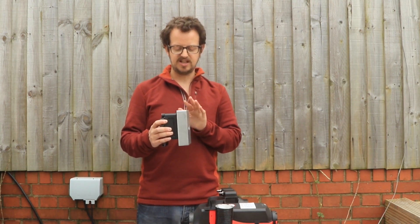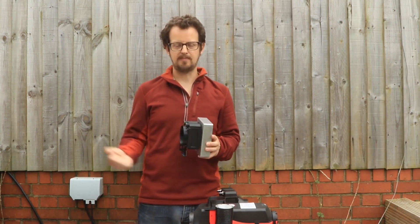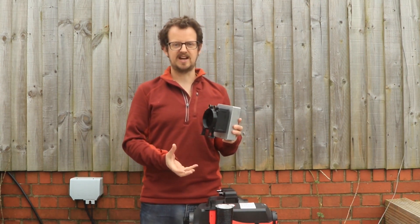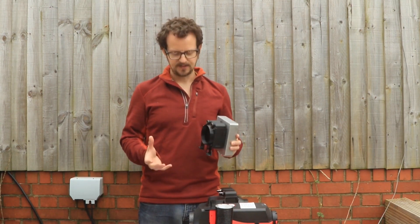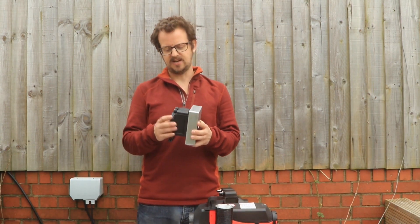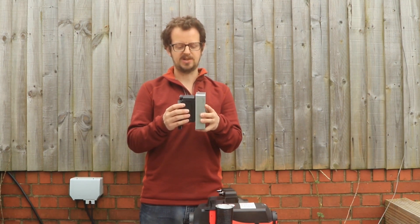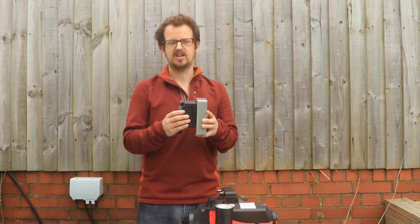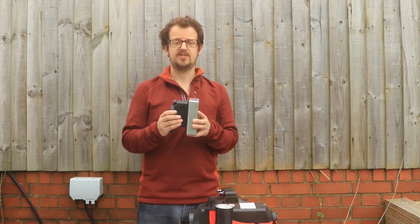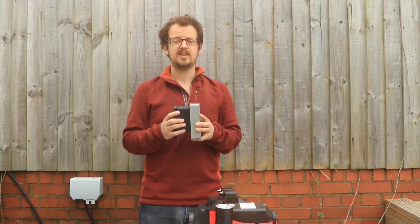I would probably look at putting it in the exhaust gases and I would use something like this. The reason is you really want to avoid back pressure in your exhaust if you can. If you get back pressure in your exhaust you'll get sooting inside the heat exchanger and you'll constantly be clearing it out, and that's just no fun. So go for something like this, mount it safely, make sure it's ducted well and keep it out of harm's way — make sure it's not exposed to the road — and you should be fine. Thanks for watching, we hope it's been interesting. If you have any comments or questions write them below, we'll try and get back to everything, and happy van building.